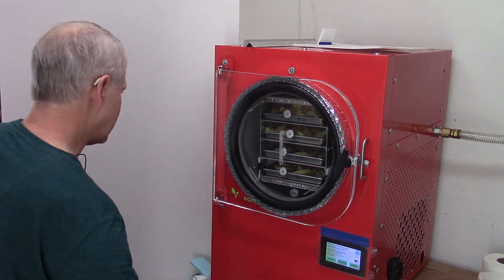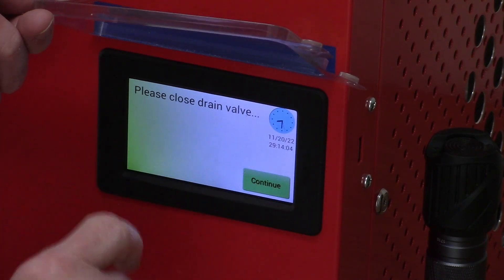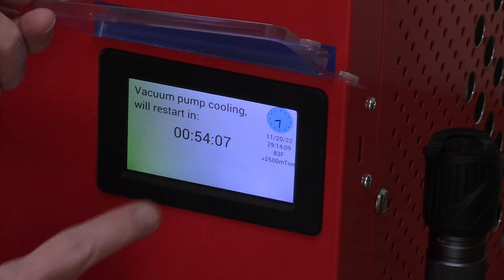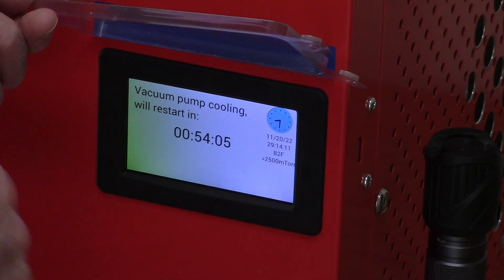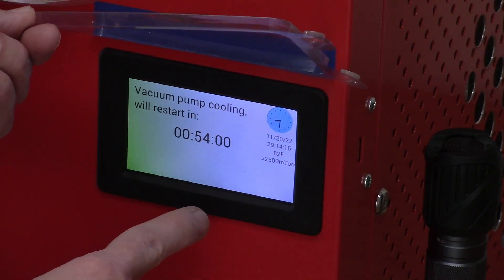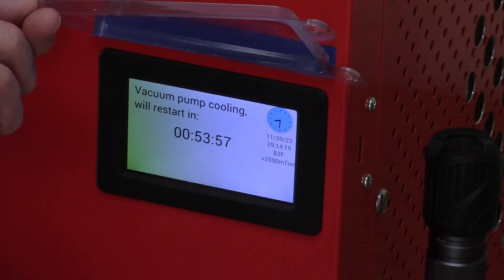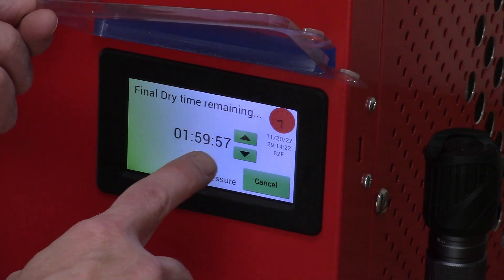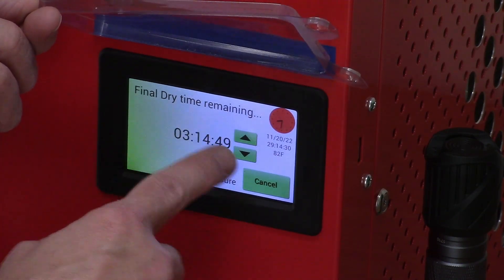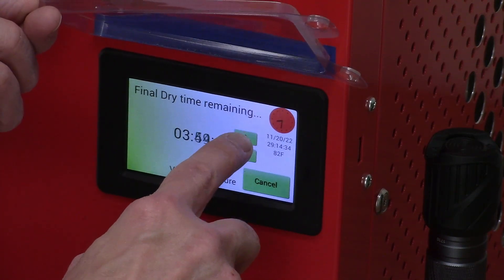Let's get it restarted. First, close the drain valve, add more dry time, and continue. It shows that it took me six minutes to do that process — you could actually do it in probably one minute if you're not trying to take a video. I'm going to bump it up to four more hours. This goes in quarter-hour increments, and the new one goes in half-hour increments — half hour would be fine, really. That gives it four hours of drying.